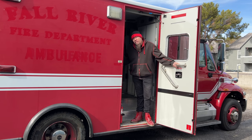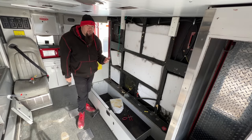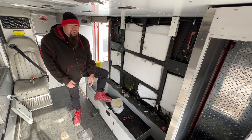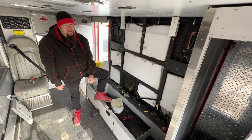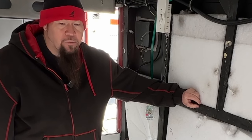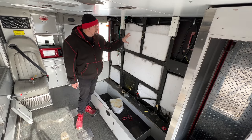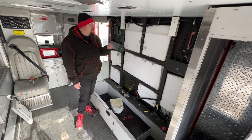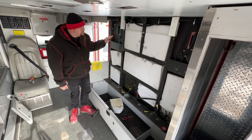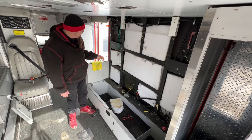Let's go inside. When you start ripping these things apart, you realize what makes an ambulance so much greater than an RV or a box truck. I have a Sprinter 3500 high-top dually, but it's just a tin can — the amount of work you'd have to go through to insulate it the way an ambulance already is. Look at these aluminum beams, how close together they are, all welded together. Look at this insulation — they use an insulation that won't mold, won't corrode, won't rust. None of this is ever going to rust or mold or corrode; it's antimicrobial and resists water buildup. They epoxy coat it to protect it, and it's all pre-wired with electrical.